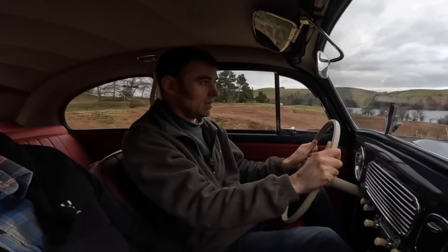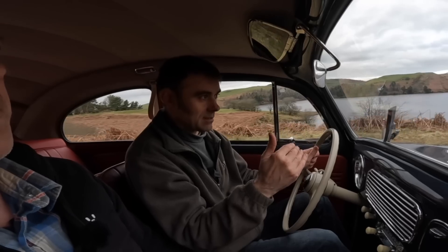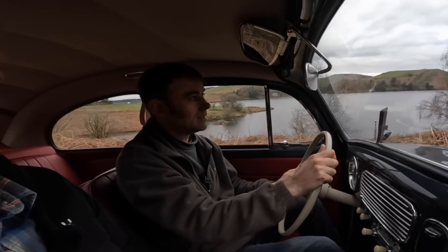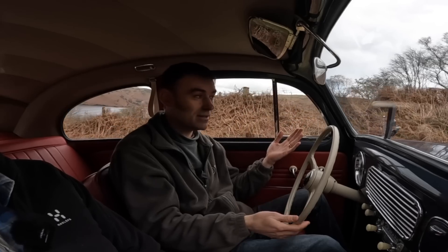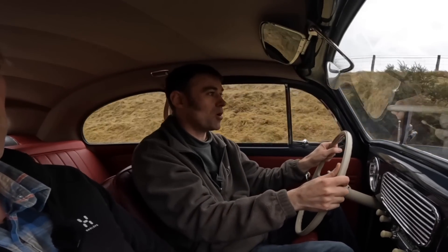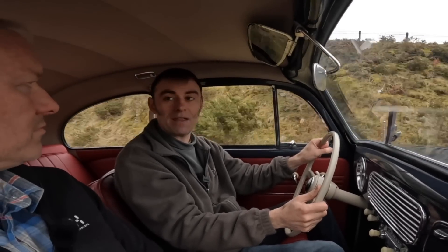Let's test this regen setting. On this straight I'm going to come off the pedal — that's better, that's better! And as we come to a stop it's increasing gradually — yeah, perfect, nailed that straight away. It'll be interesting to see how the reduced power handles going up the hill. There's a big hill here so let's give it a go. We're waiting for a van doing a three-point turn in the middle of nowhere. We're on quite a steep hill and I'm holding it on the accelerator — no clutch control, no brake, just the accelerator holding us on this steep hill. That's plenty of power!